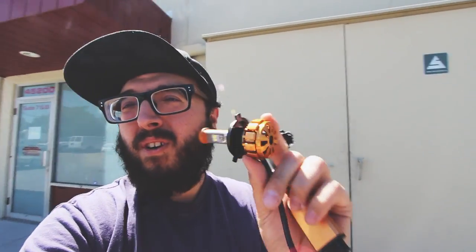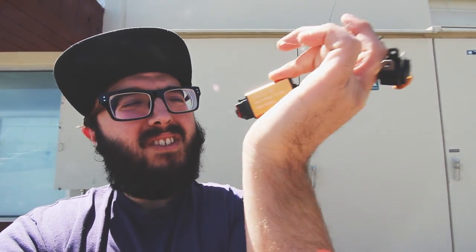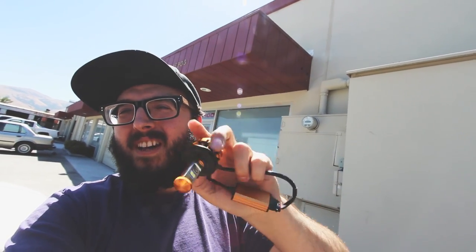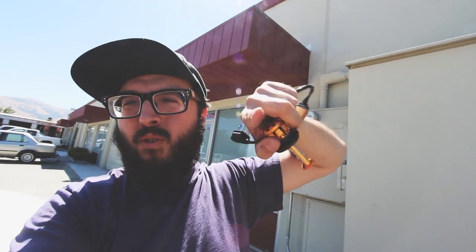The fan keeps it cool because LEDs don't get crazy hot, but I'm sure they will get really hot at high output. I'm glad the ballast is actually this small - it's not going to cause any problems. It should just lock in right to the OEM location. If you haven't done this before, when you take off your light there's a little metal clip you push to pop it out. Then there's these three little prongs - you put that in the hole, give it a little twist, and the metal prong flips over and locks in. I'll go ahead and show you that right now.